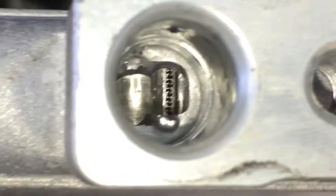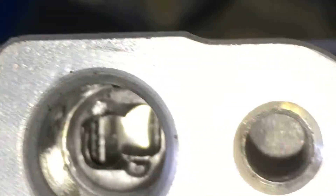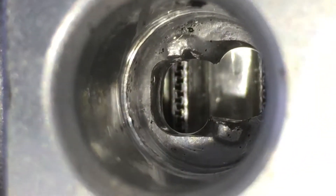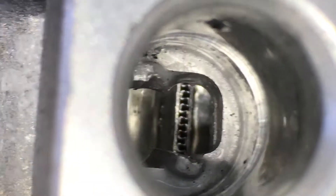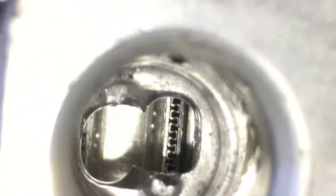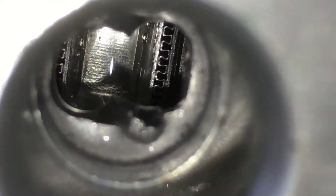Now let's look inside. Do you see that? That's one of the tubes right there. Can we see the other one? You can see the other one right there. Do you see the fins that they have built and constructed inside the tube surfaces? Do you see how many fins there are in there? The aftermarket ones do not do that. The more fins you have inside your tube, the more surface area you have, the more heat you can remove from the refrigerant when it's pumping through there.